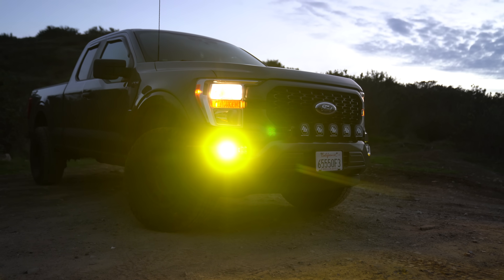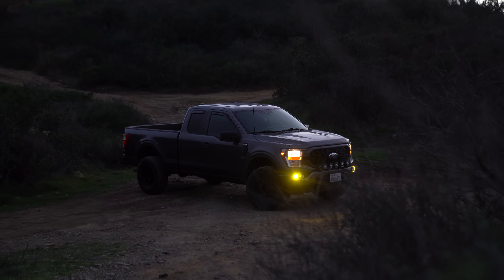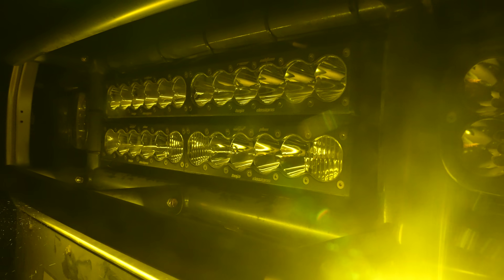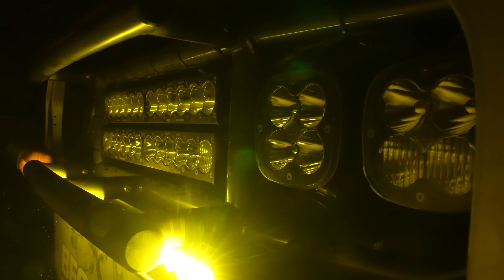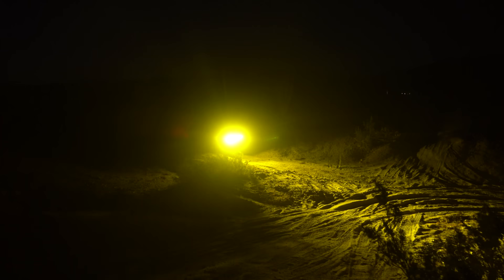Amber can be achieved in a number of ways. In the past there have been LEDs and bulbs, but the reality is that the output is just not there, and you get a lot more performance by pairing it with an amber colored lens. Fun fact: our lights actually aren't amber — we use it as a generic trade term. We use selective yellow based on years of experience in racing, as there's a reduced amount of lumen loss, and it registers more on a 3000K color temperature scale.